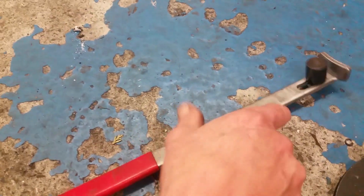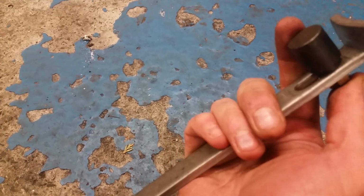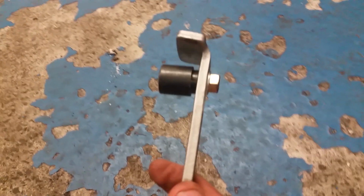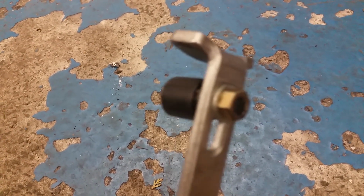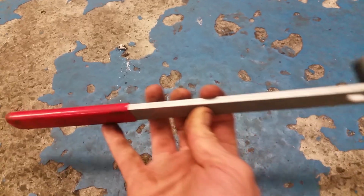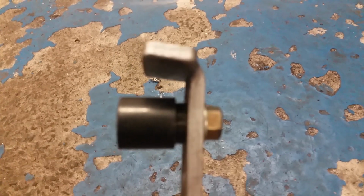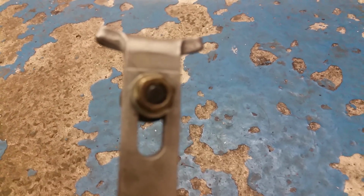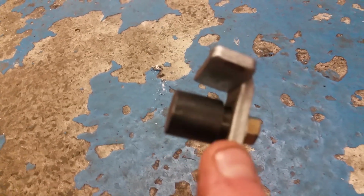You know, another not so great tool. This is designed more for cam wheels, camshaft wheels with belt driven. But as you can see, it just bends out of the way if anything's tight. It's not thick enough metal, not really that long. So yeah, not great. It just sort of pushes that out of the way, and it's only held on one nut, so it can either slide up this wee path here, or just bends as it's done there. So not up to much.